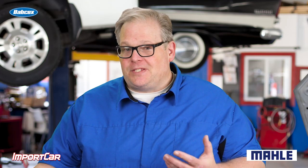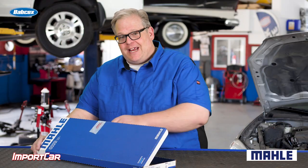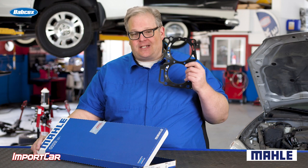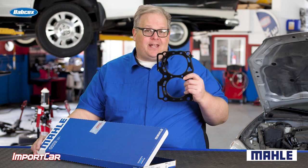You've probably seen it in a couple different parts stores — it's the spray that you spray onto a head gasket. Chances are your grandpa did it, your father did it, but for today's modern gaskets it's not required. This copper type spray is designed to help seal between the block and the head, but it is not necessary for today's gaskets.